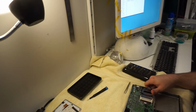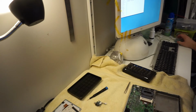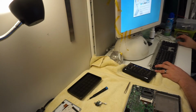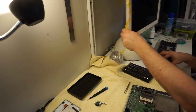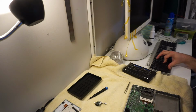So what I have unfortunately discovered is that, since this thing is booted up, I guess I should address it. So, moment of truth, ATA, and yep, sure enough, it only detects the optical drive. Bummer. Yeah, I put a 128 gig mSATA drive in here, on a mSATA to PATA adapter. Fudge. Alright, well, I'm just going to have to deal with that later. I'm just going to kick it into Open Firmware and then shut it down.